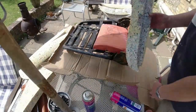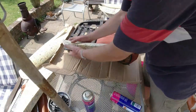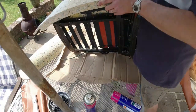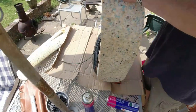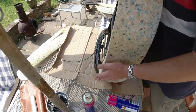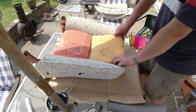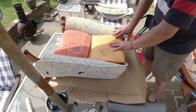I'm just using a normal spray adhesive on this — it's for car parts, but it's not the high-temperature stuff I might use for a headlining. You can see fairly obviously here how each of the foams needs to fit into the frame. Just use the glue to hold it all in place — that's all it's there for. Once the cover's on, you don't need the glue. The glue is literally there just to make life a little bit easier. These trim kits do come well sculpted, but you will need to trim certain amounts off — I just use a serrated kitchen knife to do that.